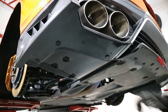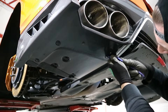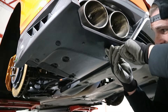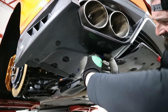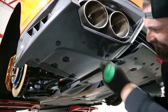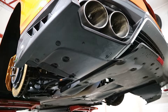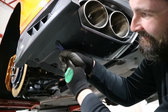First thing we're going to do is remove these trim clips there, there and there. This one looks as if it's already been messed about with — it's bent, which is a bit of an issue. I'm going to remove it from the actual inside. There we go. That one had been damaged in the past, so I'll replace that with a new one. The rest of them should hopefully come out nice and simple — and that's how it should come out.